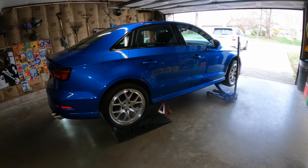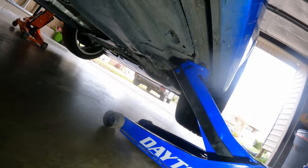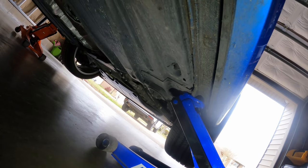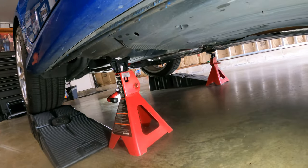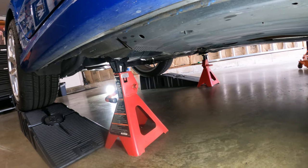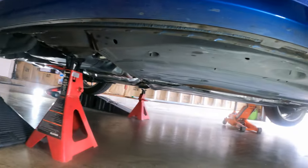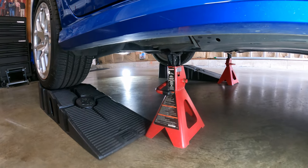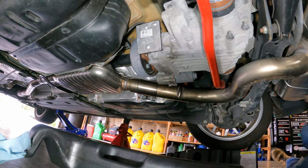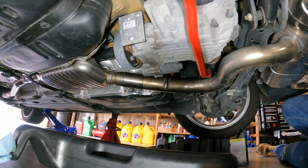The first thing I'm going to show you is my prep and vehicle layout. I've got ramps in the rear, then went with my front jacks under the pinch weld. For extra security I also did my Audi jack point jack stands for safety. A lot of people always talk about my safety — I don't show a whole lot, but I do have jack stands there for backup. I'm not going to be getting under the front right now. This is the broken GoPro by the way — I'm waiting for a small case for my new one before I risk it.